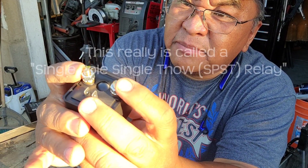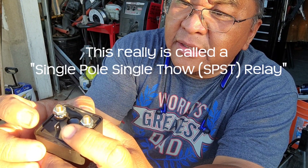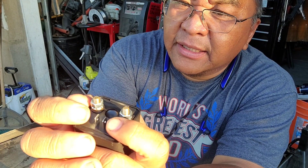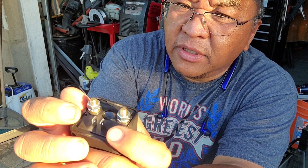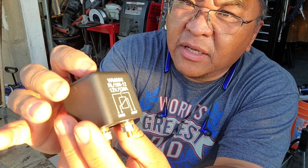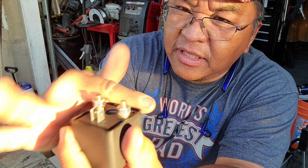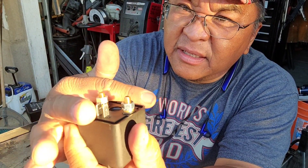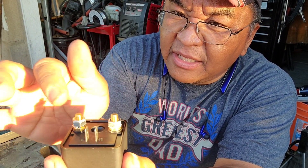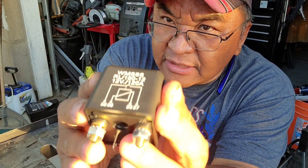These are line posts, and this is the coil right here. If you pass a 12-volt electrical charge through this post, there's an electrical conductor — a coil — in here that magnetizes a switch, which connects these two together and passes electrical current between the two posts.